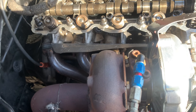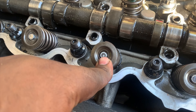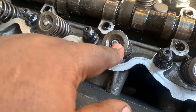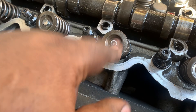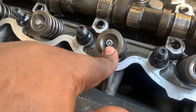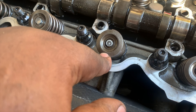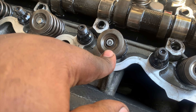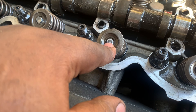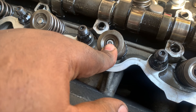So that's what you want to feel. When you take and compress this and remove the locks, you want to make sure you don't drop a valve, because if it goes in there you're not going to be able to get it out unless you take the head off — which is a couple more hours of work. To avoid that, make sure the piston is at top dead center. When you take the locks off, the valve doesn't go anywhere; it sits calmly on top — it doesn't slam, it doesn't damage anything, it just lays on top.